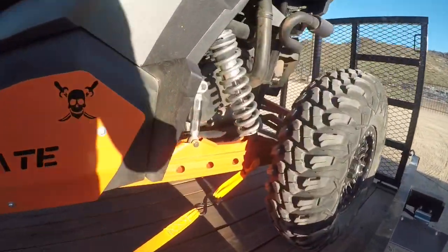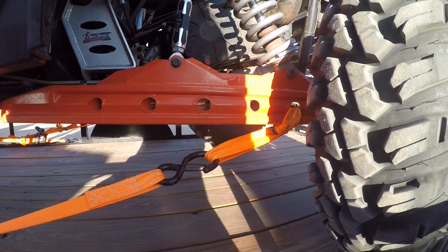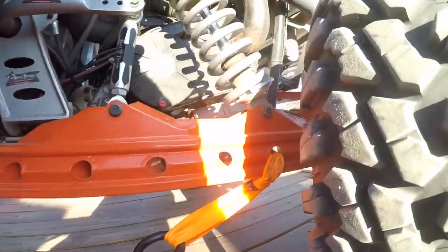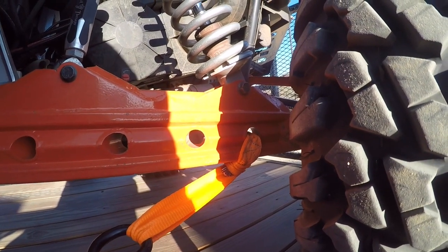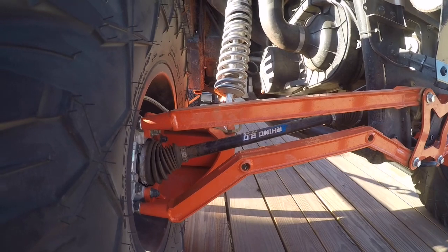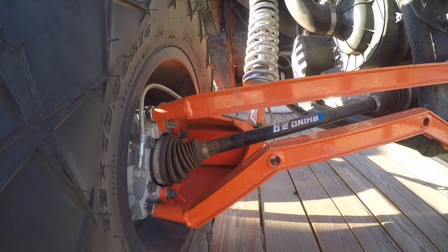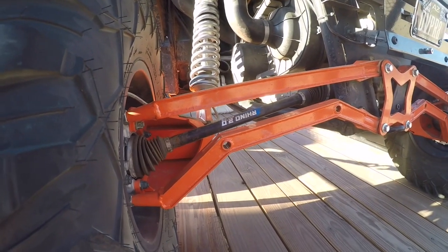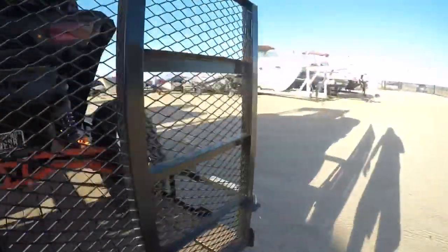Now back here on the rear — same thing — you want to get them as close to the hub as possible. I have the heavy duty Super ATV trailing arms, and they've got these nice little holes that go through them. So I've actually taken the strap and put it on the last hole in there. Some people will tell you that you can tie to the radius arms — I choose not to, that's just my personal preference — but you can tie to that lower radius arm. Only connect to one; do not wrap your soft loop around both of them. You'll end up crushing them and breaking those off. You can do it to one or the other, preferably the lower one.